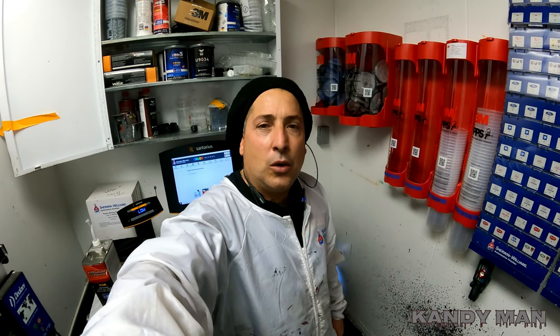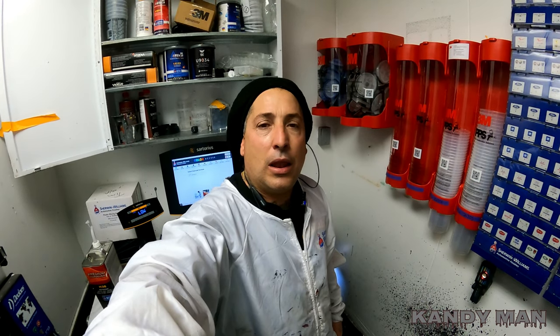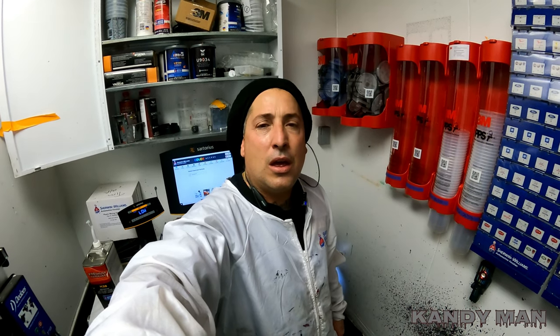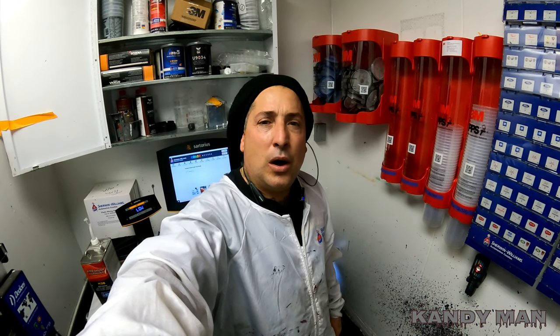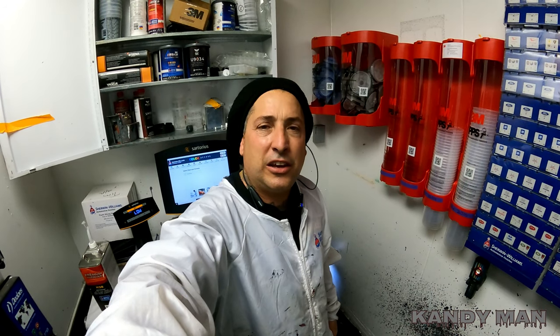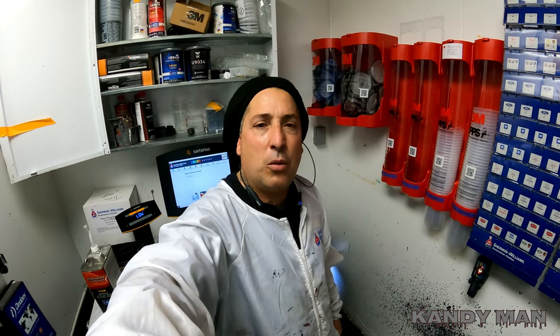They make these guns now for high solids clears a lot of times, and I know a lot of you guys at home aren't using a real true high solids clear. So I'm going to show you how to turn down the pressure, get a slicker finish, and not have to try as hard to put it on and wonder why it's pinching up on you because your clear is kicking fast. You put it on slower, which puts it on wetter and gives you a slicker finish. Let me show you how that works when I get to that.